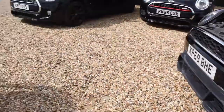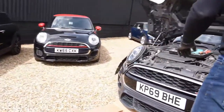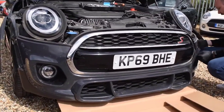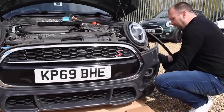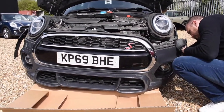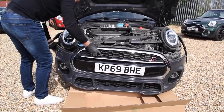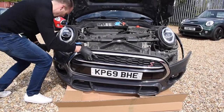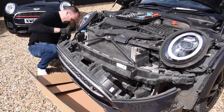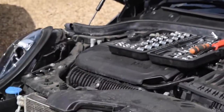Without further ado, let's bring our box back because we don't want to damage our front bumper - now the bumper's coming off. We'll give it a little jiggle and a wiggle. We're going to head round to the fog light at the front because she's going to have wires behind her. We're just going to reach round and pop off the wire at the back. So now the bumper is off.